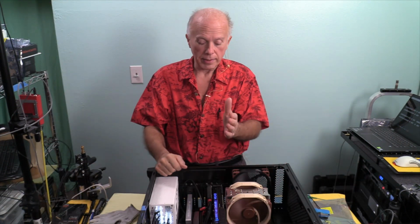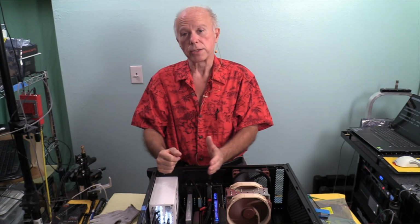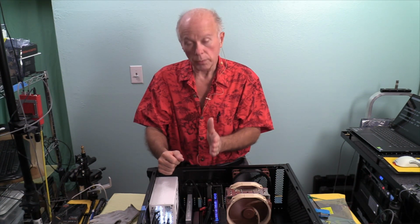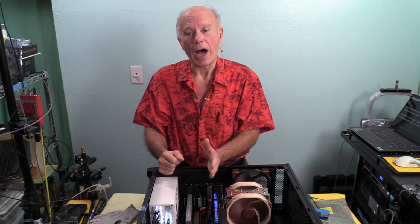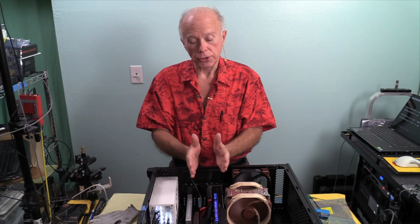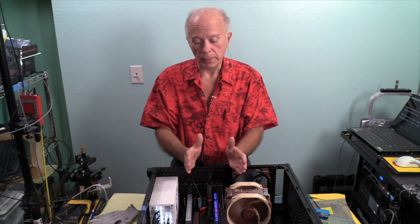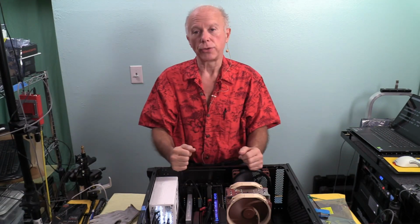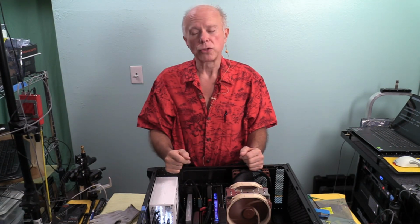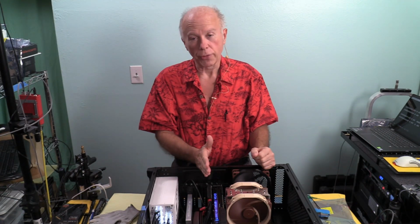There's not a whole lot other than we're going to look at the card physically and examine it and compare the two. But once we get it installed and go through the driver issue, I think the big takeaway from this is, number one, we're going to take Thunderbolt 3 out so we can get the drivers done. Realistically, what I should do is uninstall the driver. I'm not going to. So Windows is going to go through several reboots until it re-recognizes the new card. But when I install the new video driver, and once everything's all hunky-dory, then we'll come back and put Thunderbolt 3 back in.